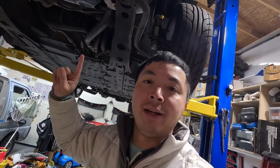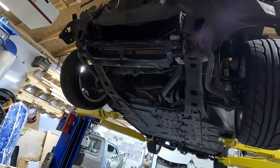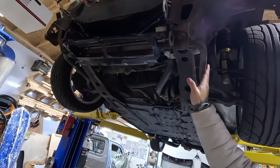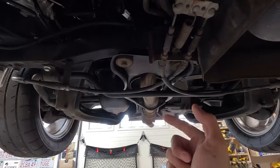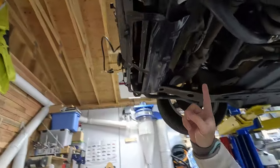The OEM bars are 25mm in the front and 20mm in the rear. Back in the day when Mazda Speed offered things for this car, they offered an upsized anti-roll bar front and rear. The front went from 25mm to 28mm and the rear went from 20mm to 22mm — so increasing 3mm in the front and 2mm in the rear.